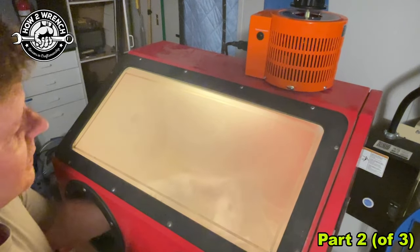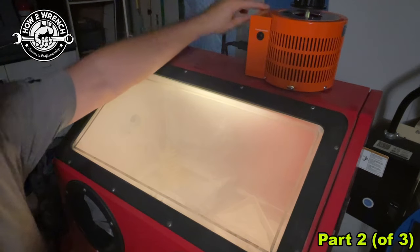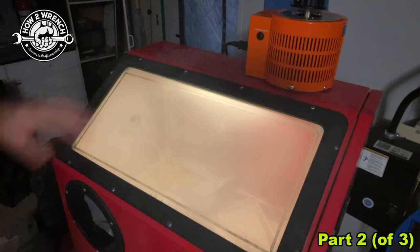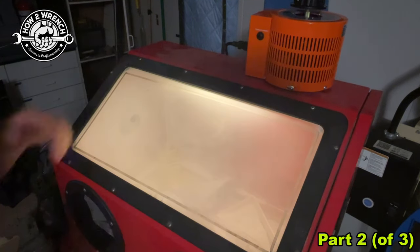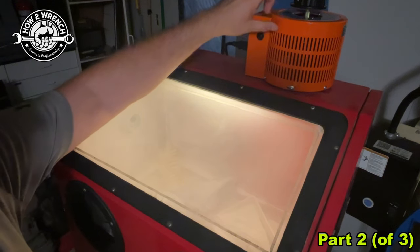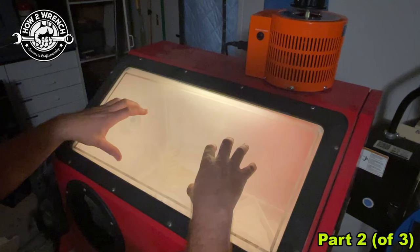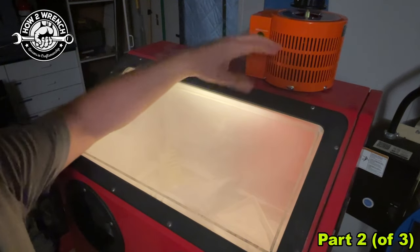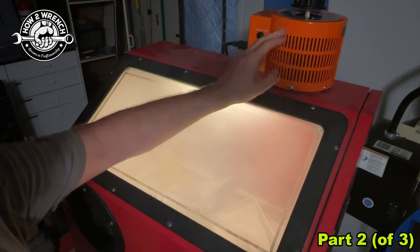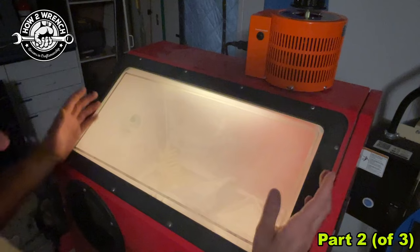Since I know the Variac is controlling the fan, I could start to use this as a power-off — instead of leaving the fan on a separate switch, I could just leave it on the Variac. That's another option. I may put an indicator here and make a little mark or label that this is for the soda blaster, because it's a smaller cabinet. And maybe my regular sandblaster with the walnut shell likes to be at a different setting — I could label that and have it ready for quick reference to set up for that larger cabinet.